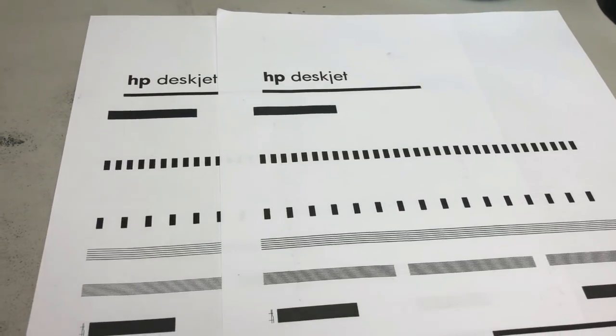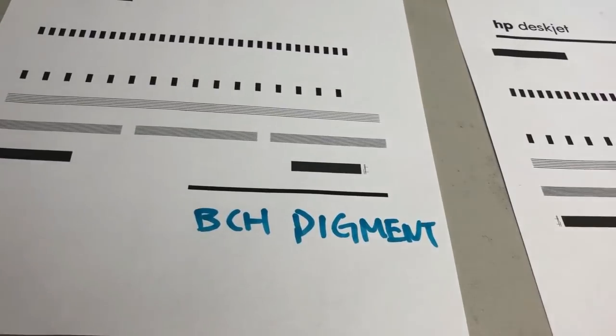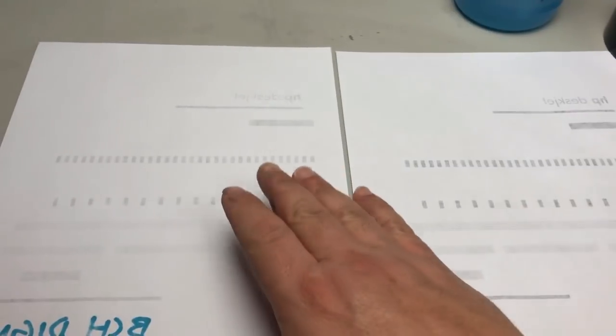Another thing is the bleeding. Okay, and that's not much actually. The bleeding is if you print on double-sided paper, on the back side, you can see I used a permanent marker. So once that pigment has already penetrated next to the other side. On the back side, the concern is because the dye ink is penetrating, and if you print double-sided pages, you're going to have ink loss going to the second page. If you use regular papers, there's no concern. It's about equally penetrating, so there's not much difference if you just use regular paper.